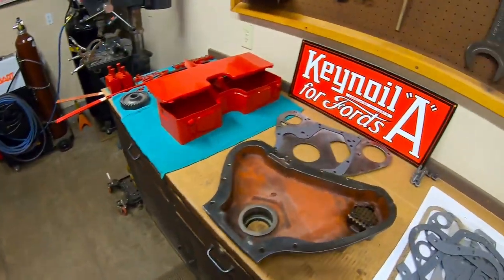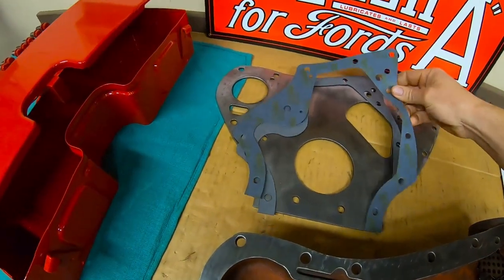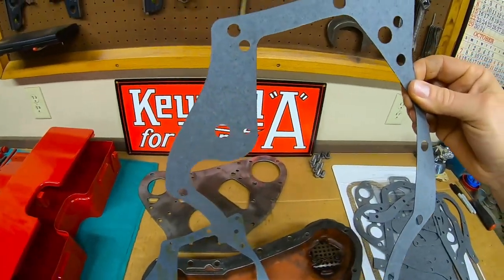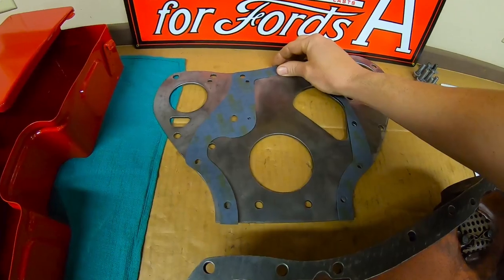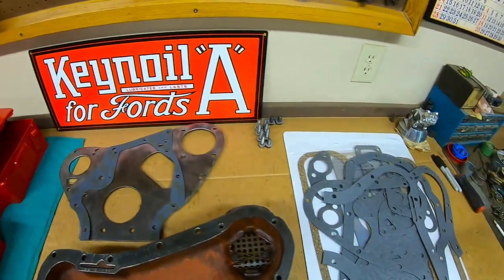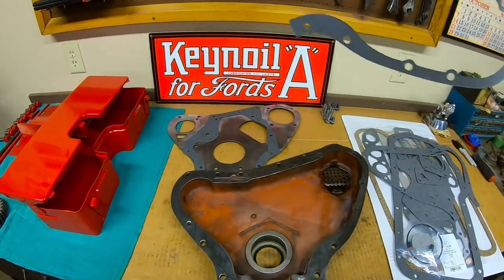Because both of these pieces are under so many other things on this engine, I'm going to remake these two gaskets. I've already remade the intermediate cover gasket out of a known good grade of gasket material — that was fairly straightforward. Since the old gasket was good enough to work, I just used it as a template. But we don't have that opportunity with the front cover gaskets, so we'll make those from scratch.